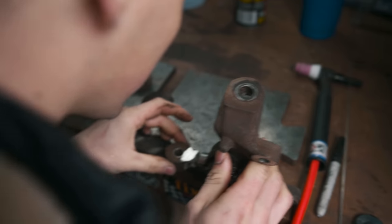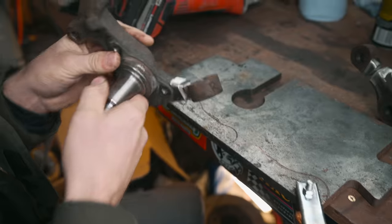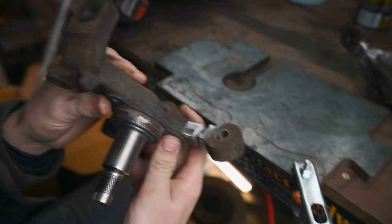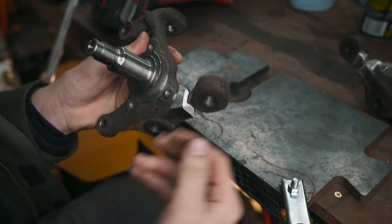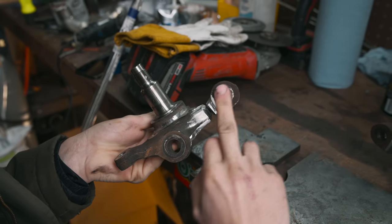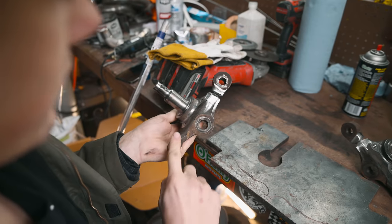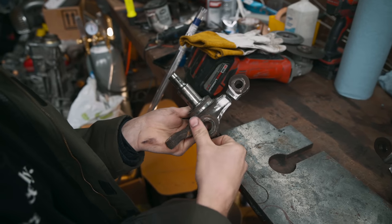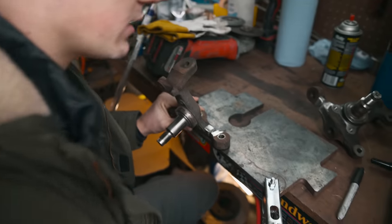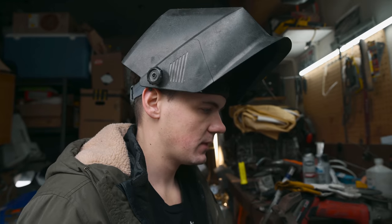This is all the material that we're going to have to fill in. I'll tack it up and visually check that the Ackerman looks about the same. On Miatas, all I did was make sure this ball joint flat surface is the same level as this. I just let the knuckle sit on the steel but not go over to this little brake caliper mounting - just flat, sitting flat right next to it. I'll make sure they both have the same Ackerman and then weld them up.